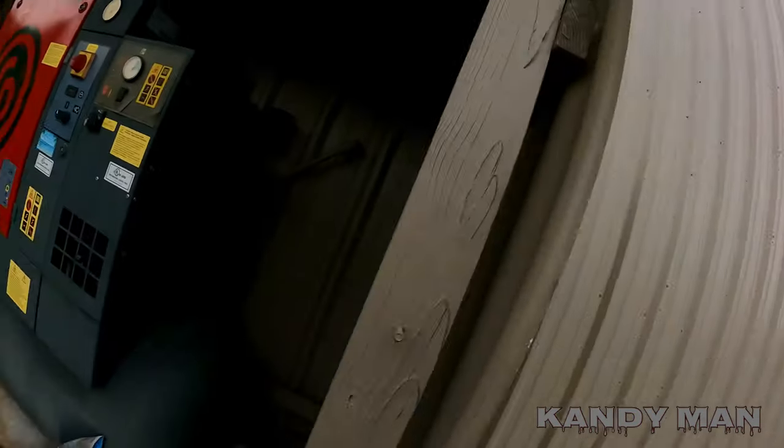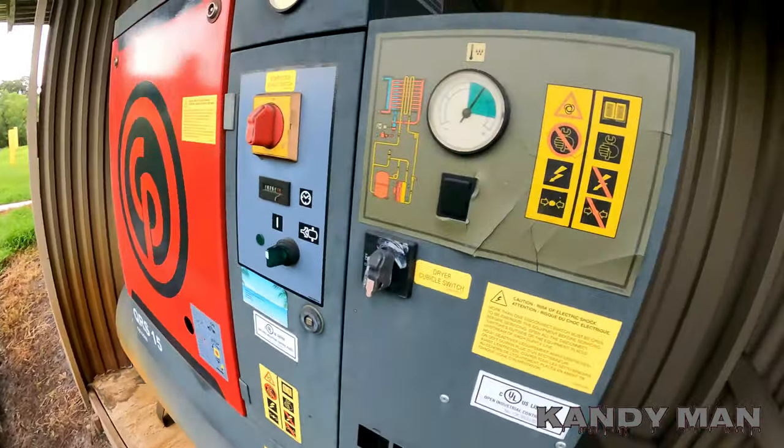so that way it drains the tank on you. So sometimes you guys got to think, it's not just what's on the panel, it's what you're putting through your airlines that's causing some of your fisheye problems. When you have a small compressor, it's really working hard to try to keep up, so it's running real hot and you're causing a lot of moisture. So a key to me is what I used to do is, let me step away here for a minute. So this is the compressor, because it's getting loud, but just wanted to show you that.